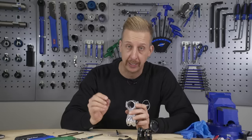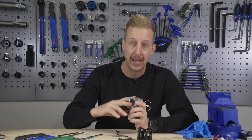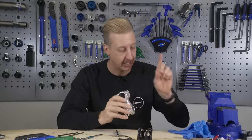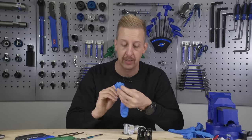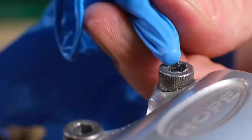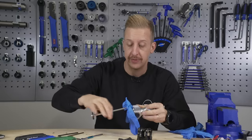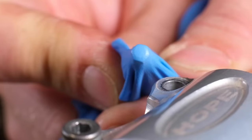The concept comes from drilling with screws - it's quite easy to round out the head of a screw, but you can add extra traction by putting a rubber band over the top and leaning on your screw bit to undo it. Now, a rubber band isn't going to fit inside this. However, rubber nitrile gloves do and they give just enough traction if you wrap the glove around the end of the allen key, maybe twice the thickness, and get it into place. It just adds a little bit of security and you can actually undo it. That is your first port of call - it's non-damaging to the bolt and non-damaging to your allen key.